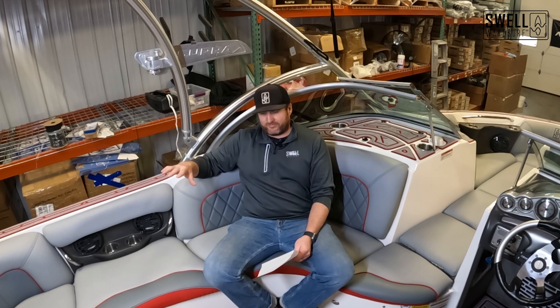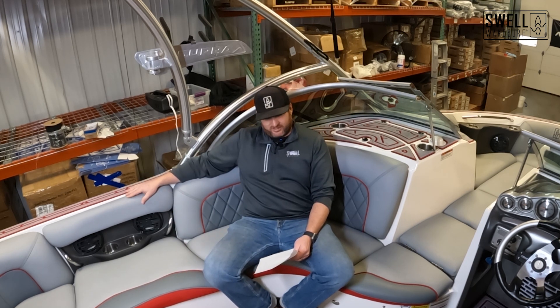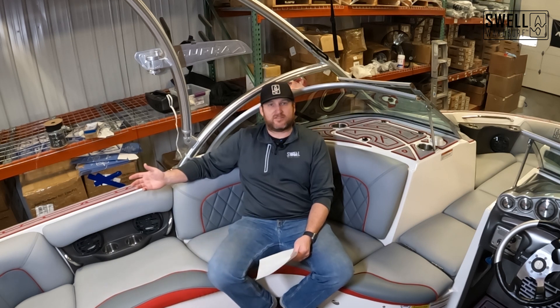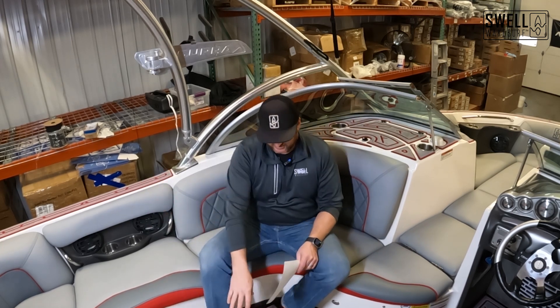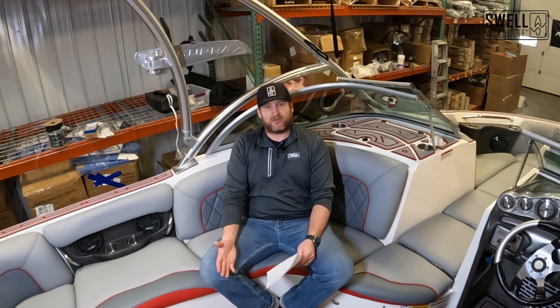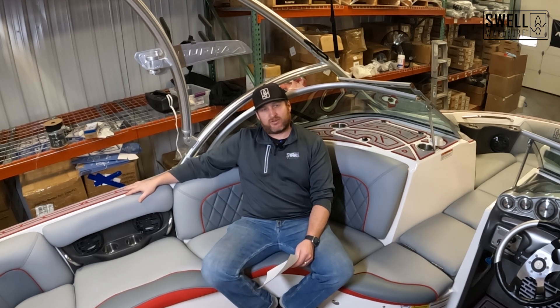After that, we sanded and cleaned off the floor, then did the epoxy on the floor. We spent about $250 on West Systems epoxy — we bought way too much, using only about 24 ounces total, so if you can find smaller quantities, do that. You could probably get the whole floor done for $100 given the limited surface area with the walk-through raised area. We also replaced an aluminum panel that had two big gaps with an HDPE board — a 4x8 sheet from CalSAC Plastics here in Minnesota for $400. We didn't use it all; it's been used for other projects as well.